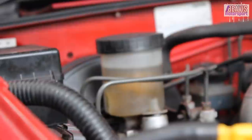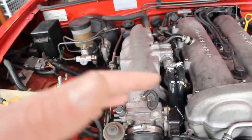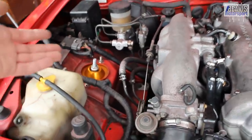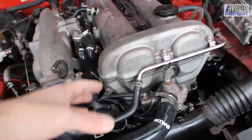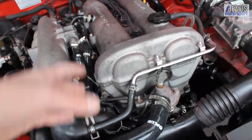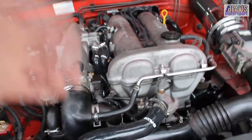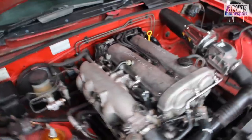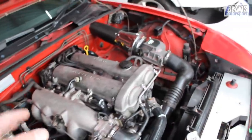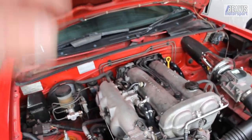While you're there, check your fluid levels on your brake and clutch master cylinders and your radiator overflow. If any of those aren't within the marks, I'd be questioning why the seller hasn't checked on the most basic maintenance. Also ask your seller about when they last did their timing belt — it's really easy to forget to ask, but people should be doing it. I don't think I've ever seen a timing belt fail on an MX-5, but if a seller doesn't know when it was changed, you'd be wondering — can they provide proof of service around 100,000 or 200,000 kilometres? After a test drive, come back and check for anything overly hot or unusual, like boiling fluid in your overflow or steam or smoke coming out somewhere.